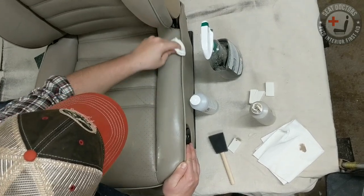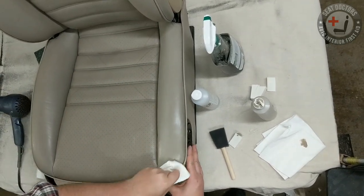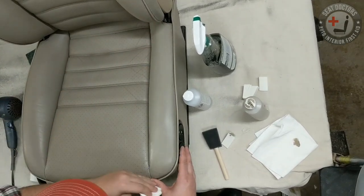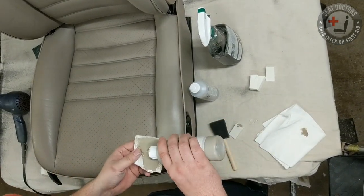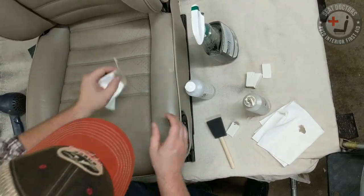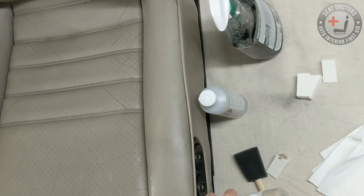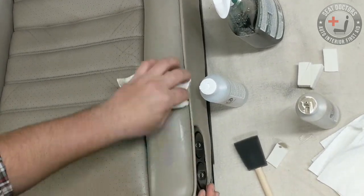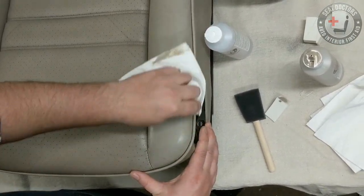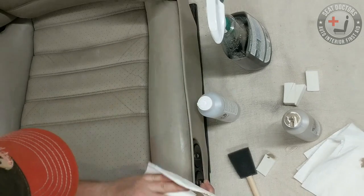And so conditioner's going to protect the rawhide and keep it soft and supple, keep it from cracking. And then when you apply leather dye on top, you're protecting those cracks. Because as those little cracks form, now those cracks are susceptible to UV damage. They're susceptible to water damage. So the more you keep the top coat protected, the more you're going to protect the rawhide underneath. So it's kind of a symbiotic process. You're protecting the top coat with dye and protecting the rawhide with leather conditioner.